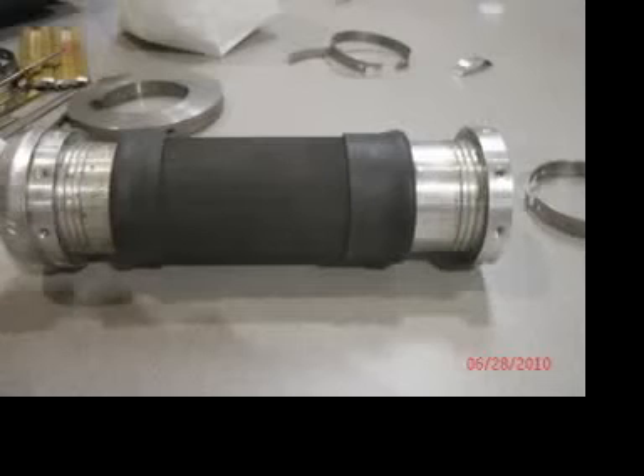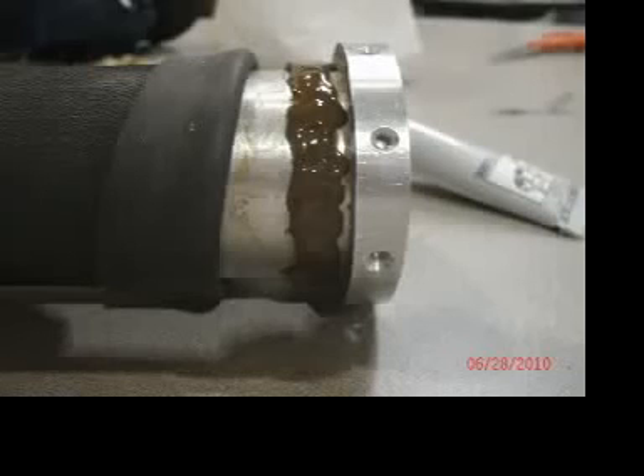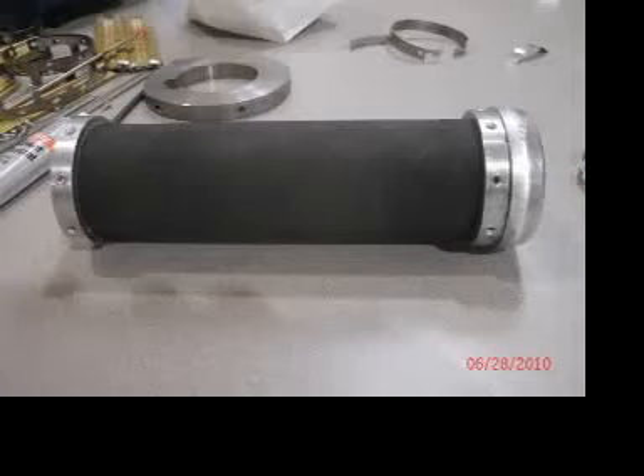Next, fold the ends back. Since the bladder is a tight fit on the core it's not going to move — simply peel the ends back and that will expose the ends to put the sealer on. A sealer called Permatex number one is what was originally used by JRC and it seems to do a good job. It's easily available at almost any auto parts store. There are other things you could possibly use, but I do not recommend using silicone nor a non-hardening sealer like Permatex number two. You need barely enough sealer to cover the ribs at either end.